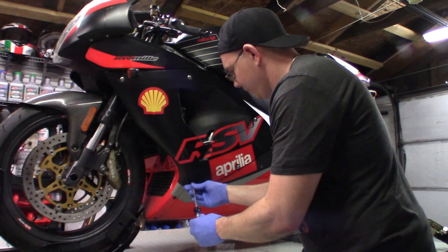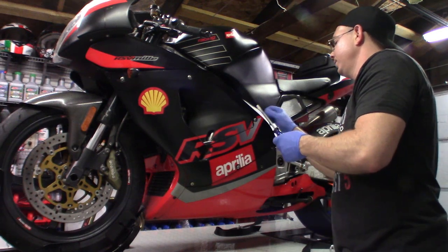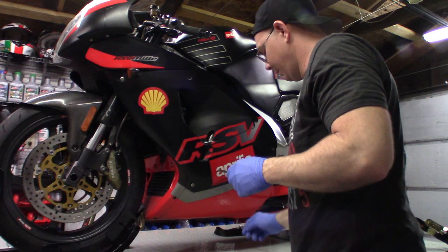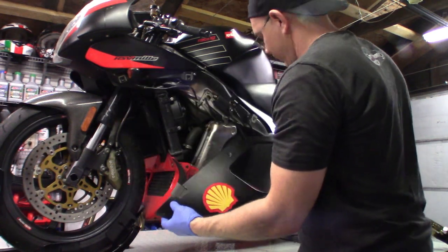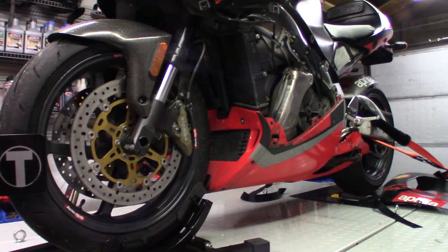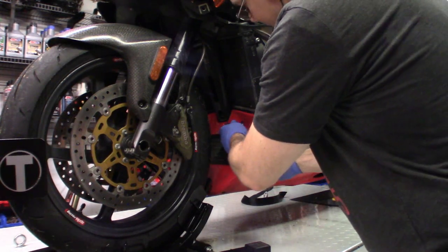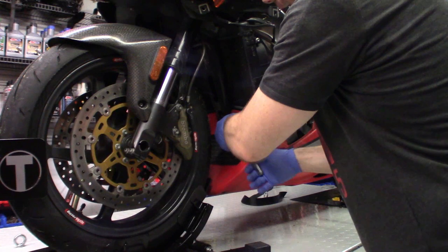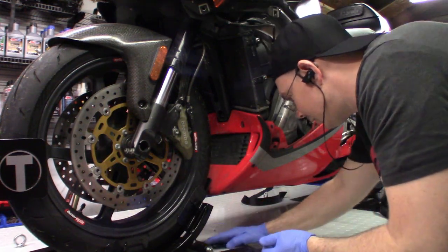Some of them will have an o-ring on the back so they don't fall out. If your bike's been through a few owners they're probably going to fall out. This is just the extra mile that the Italians go compared to Japanese manufacturers. To get these off quickly you're going to need four millimeter Allen wrenches — one on each side of this belly pan. If these bikes have been apart more than once you're probably going to have all kinds of different bolts in here.